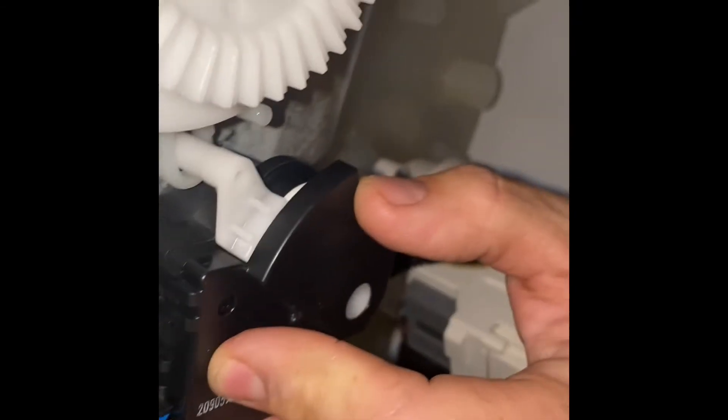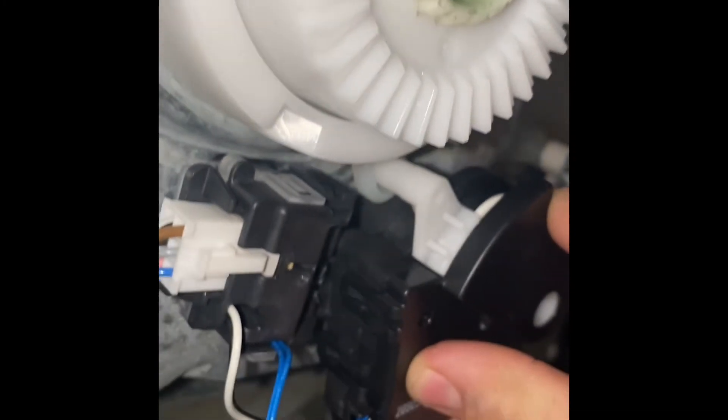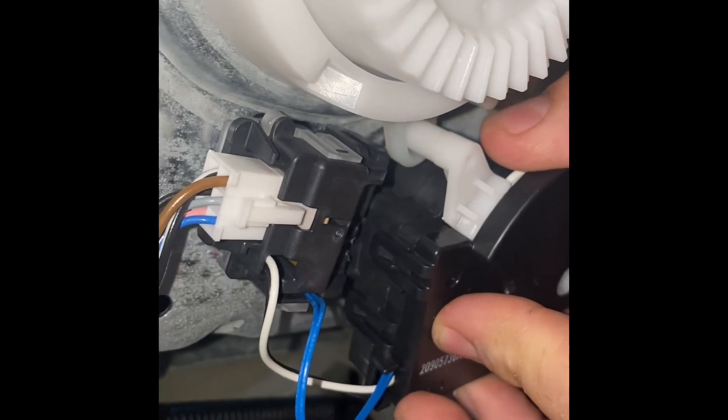That's what's wrong with it, and that's why it doesn't wash — because that actuator arm slips off the cam. She gives the model number of the unit.